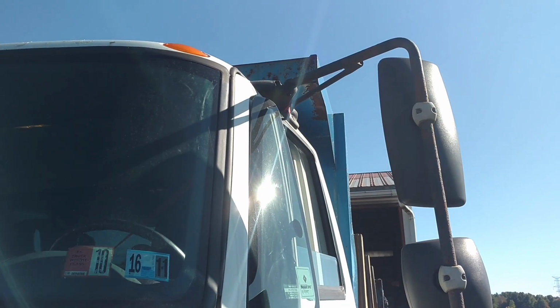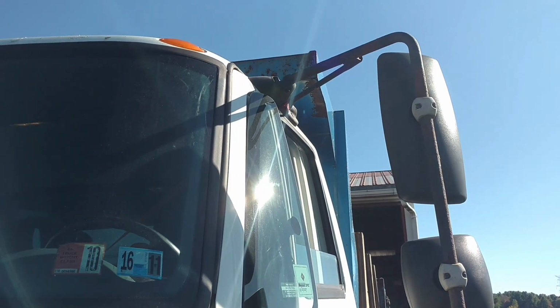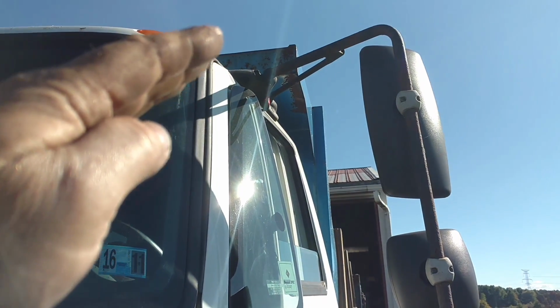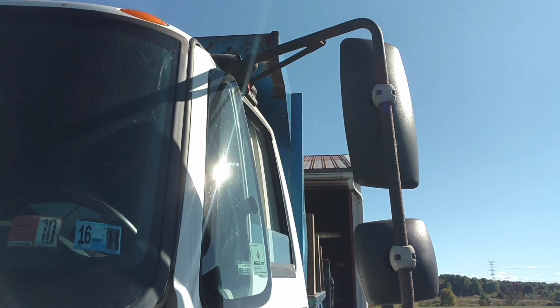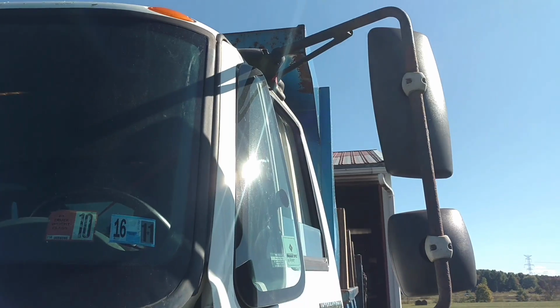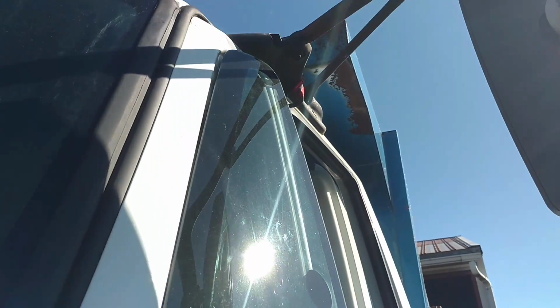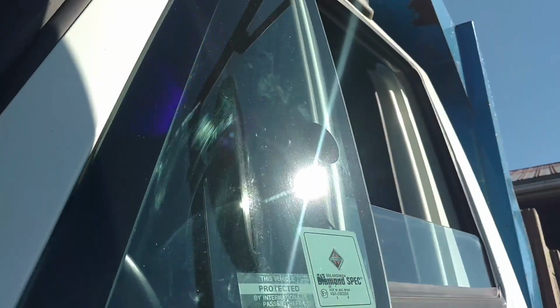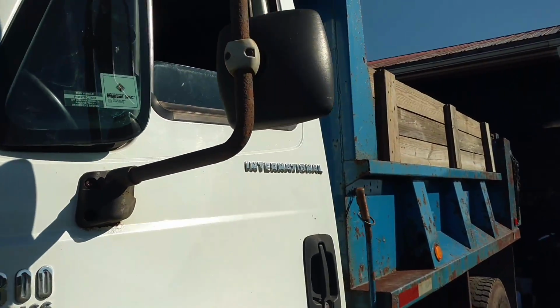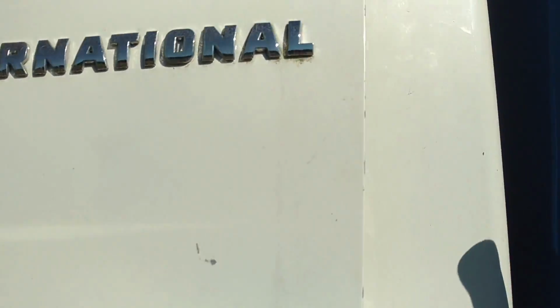Alright, so that ratchet strap goes from there to this passenger side seat bottom, real down low, because we're trying to pull this way. We don't want to just pull straight in, we want to pull down at an angle. And you can see we're inside the weather stripping, so it's got a pretty good bend on it this way. And you know, this is a preferred method of POS body work.